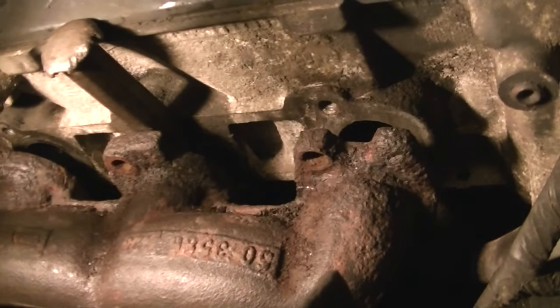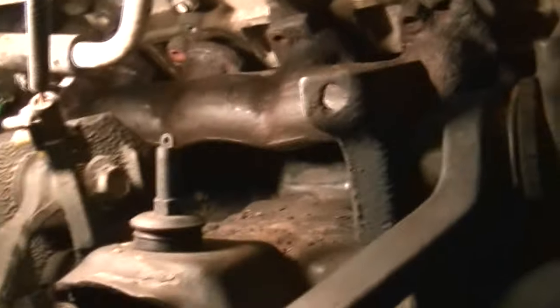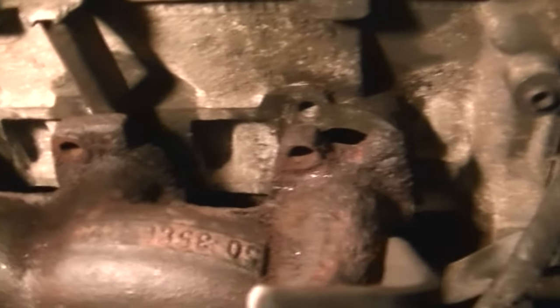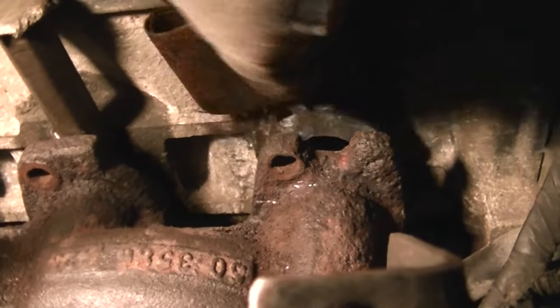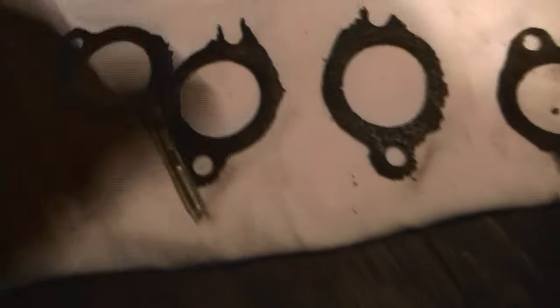The chisel you see right there is just my little spacer to hold the manifold apart. This may help you — I took a piece of sandpaper, wound it up, and went behind the manifold. I kind of sanded on both sides of the head and the intake until I got everything nice and clean on both sides. I also used a little mirror to see behind there, and I got all the gasket material off on both sides. Here are the old gaskets — the four pieces that were on it, very cheap, very shoddy. Once I get the new ones on, I'll be very happy. This will be nice and quiet — this was the only exhaust leak I had.